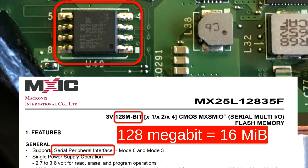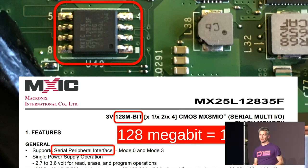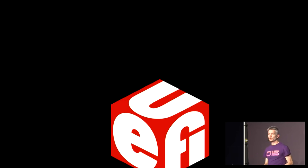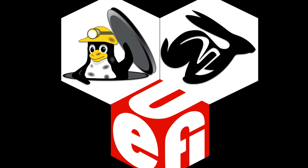These are frequently called boot ROMs — that's a bit of a misnomer since they're actually flash memory. They've replaced the 64-kilobyte ROMs in old machines, allowing much more complexity in firmware. You might be familiar with closed source UEFI firmware, which provides windowing, networking, and other functionality before the OS loads. There are also open source firmwares like LinuxBoot and CoreBoot that let people replace that firmware with free software they can read and modify.